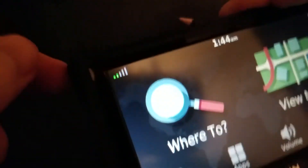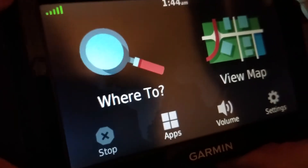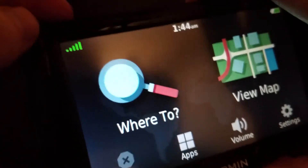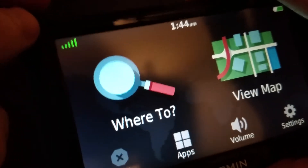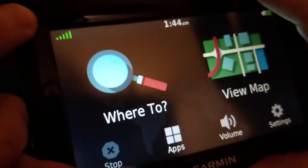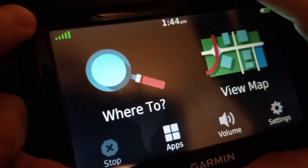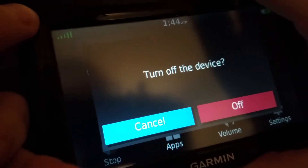Now at this point, press and hold the power button until the screen blanks. As soon as it blanks, take your thumb and press the top left corner like this. I'm going to press the power button now. I still don't touch anything — I wait till the screen blanks, then touch.